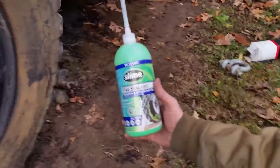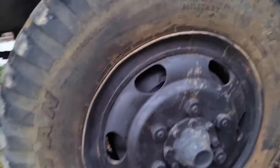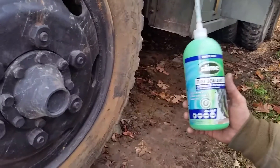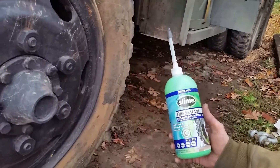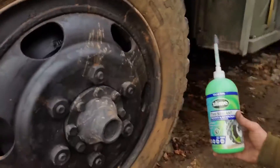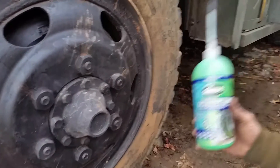I'm gonna put that all the way down. Got the truck jacked up, no weight on the tire itself. And I'm gonna get our favorite stuff here — Green Slime tire sealant. Because these are just like your kid's bicycle tires or the bicycle tires you had when you were a kid. This stuff, nine times out of ten, will fix a small hole in your tube that's on the tread side. If your tube's leaking because the tire flap inside got messed up and chewed a hole in your tube, you're up the creek and you're gonna have to change the tube out. But this will save your butt.